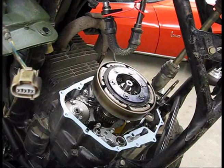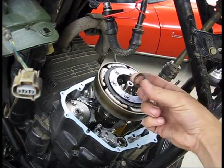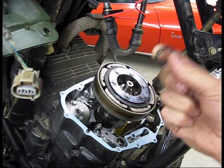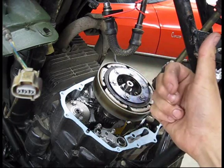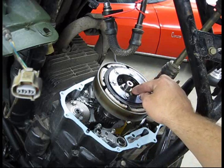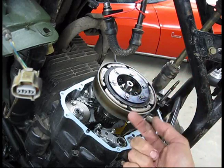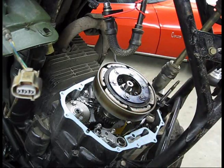Oh, one last thing. This little metal washer, this little guy right here, came off with the cover when we took it off, but this guy goes right here. This little thrust washer goes up against the housing when you put it back on, because this actually goes into a bearing on your housing cover. Make sure you put that guy back where it belongs. When you pull your housing off, if you see that guy stuck on the housing with oil adhering it to the housing, make sure you put it back here before you put the bike back together. That could also give you a bad day.